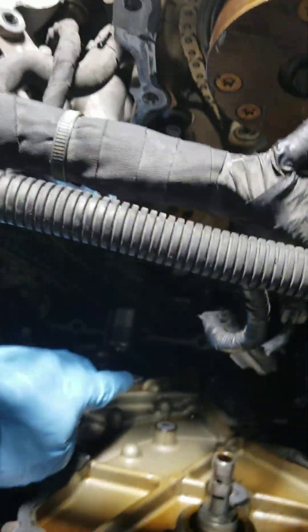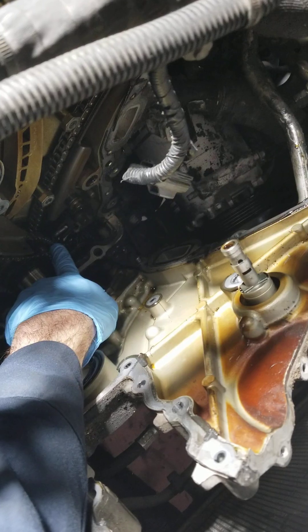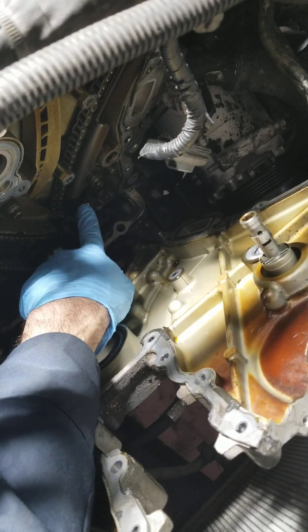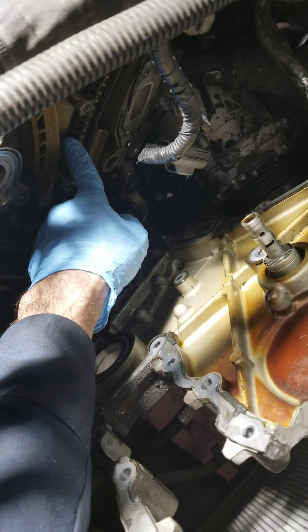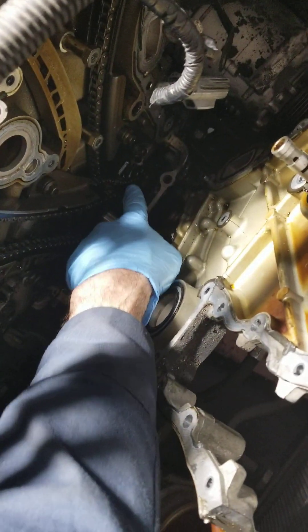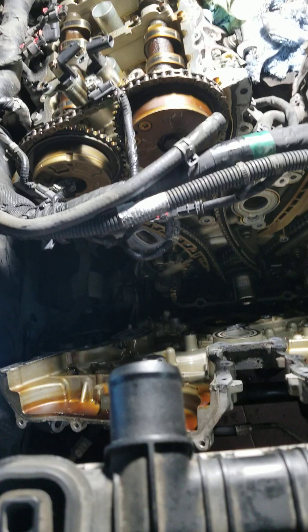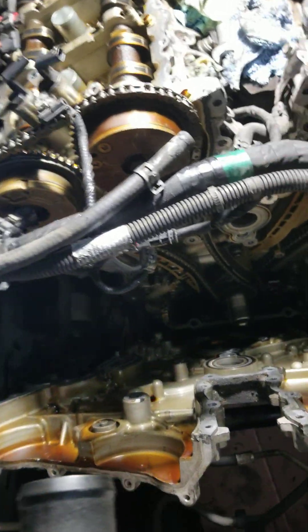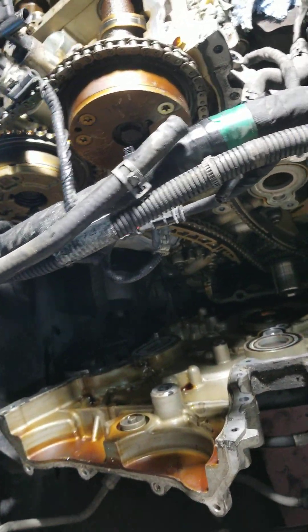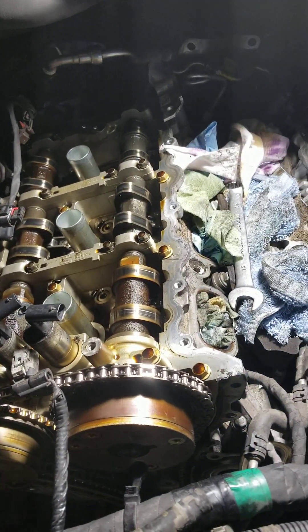The other tricky point — if you look at my finger over there — the oil pump is driven by the timing chain. We are going to take that tensioner off, loosen the chain on both sides, and hoping we can take that off without taking off the oil pan. Otherwise we'll have to move forward and replace the oil pan gasket and take the oil pan off.